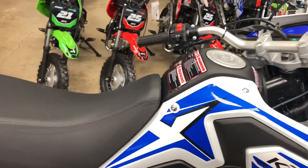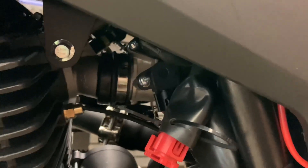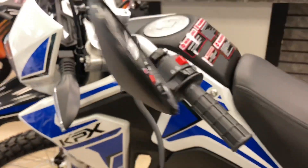We're going to show you how to adjust these over here. You've got a throttle body positioning sensor, and on this one I just took and moved it just a smidge — and that fixed our idle on this one. She should run right now, and if it doesn't we'll go to the next issue. That's how we got this KPX 250 lined out. Let's see what it sounds like now.